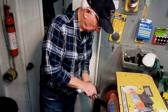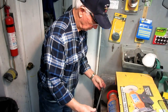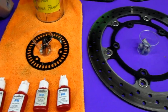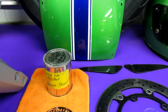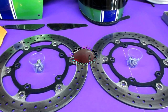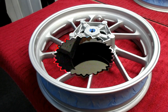I like to keep the tools clean — no paint dust or paint grit — and work like it's a professional operation even though I'm really a backyard mechanic. All the other parts for this job are prepped up. The sequencing is very important: I want to finish the buffing out before I do anything else. It'll be a lot easier to do it before the discs are on. Same thing — before I mount the wheel back on the bike I'll run the buffing wheel on the exhaust pipes while the front wheel is out of the way.